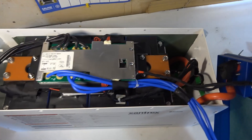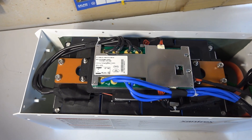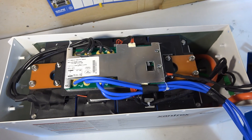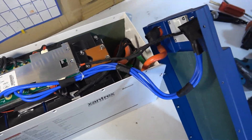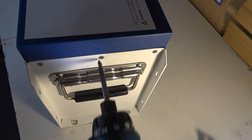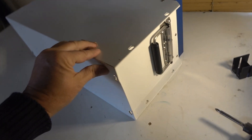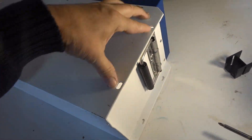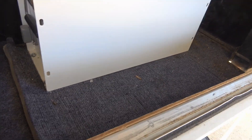We're back up and going to put it back into the camper. I'm going to try charging it at its 150-amp charge level using the Xantrex inverter charger, which can put out 150 amps, and we'll see how they mesh together for recharging. The attention to detail is really good with this battery. Looking at the bottom — it's flat, and they have mounting holes so you can mount it straight up and down or on its side.